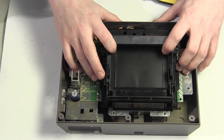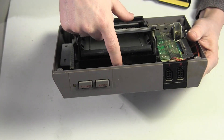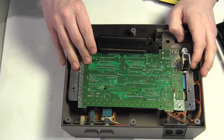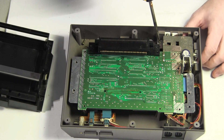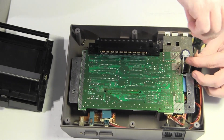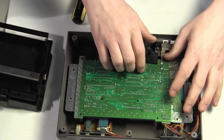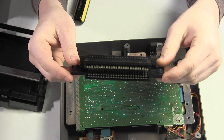You can see the size difference in the screws there. This flap is ready to slide forward a bit to get the latch underneath to clear the PCB, and then you slide it off. Right down in there it connects to the PCB, so you just push it forward slightly and then you can pull it right up and wiggle it past the 72-pin connector. Sometimes it can fight you — just be patient with it. And that's your 72-pin connector. That's what reads the games and sends all the data to the motherboard and processor so it can display an image on your TV. Now you do want to loosen off the screws for the RF and video output — that just lets the motherboard travel a bit more. You don't have to take these screws all the way out, just halfway, so you have a bit of play. Then you can lift it up a bit and slowly slide the 72-pin connector off the bottom of the teeth, working it back and forth until it breaks loose. Now that is ready to be thrown into a pot of boiling water.